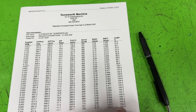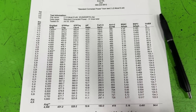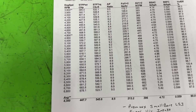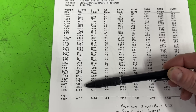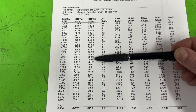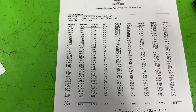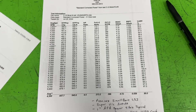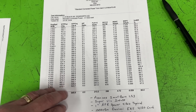Now for E85 — guess how much power it's going to gain? It went to 684. Remember, 682 before, and it did that at 6,700 RPM. The torque did jump up to 590 at 5,300. So you're like, wow, that's only a two-horsepower difference. It doesn't look like as much at all. The overlay is a better picture — let me show you that.